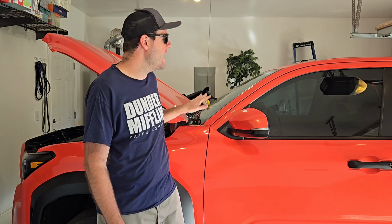And then once that's started, you should be good to take off the cables for both vehicles. Because this is a hybrid, the ready light shows up, but it may not actually turn the engine itself on, which is fine. With other cars, that's a way to know it started. But as long as that ready light shows ready, the electric engine's running, which means that it's got enough power. So that is good. That's all you need to do.